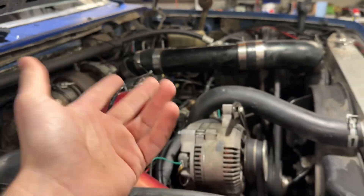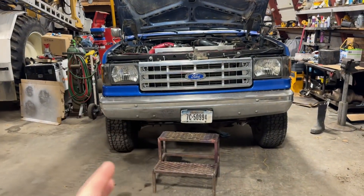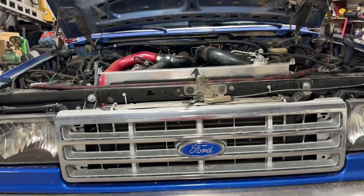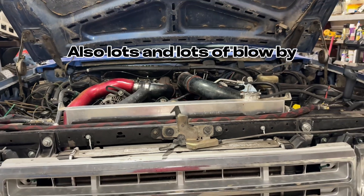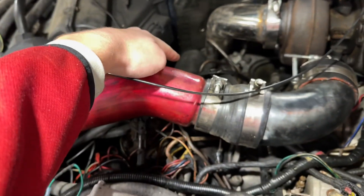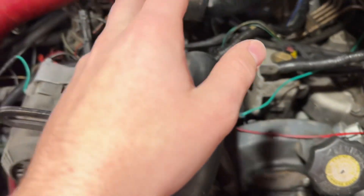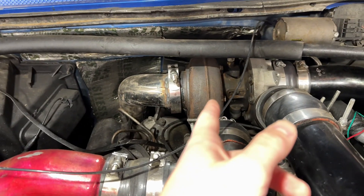It's bored 30 thousandths over. Ever since I put this thing back together I've had some issues with starts immediately off the bat. I figured it was just timing. It always smoked a bunch on startup — always kind of a cold-starting issue. This 7.3 IDI turbo has ARP head studs, R&D's injection pump, R&D's camshaft, R&D's return rails, his intake manifold, and an XS261 turbo.